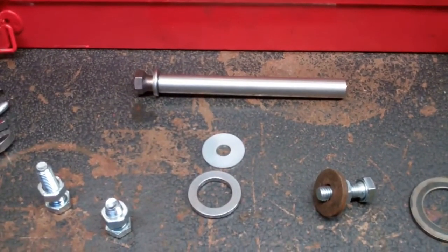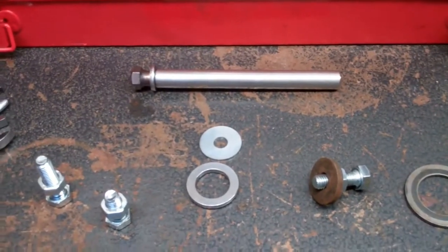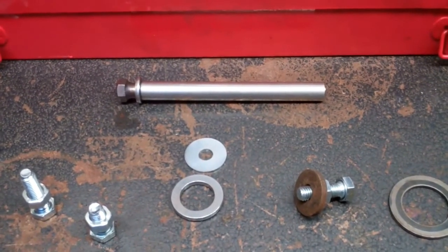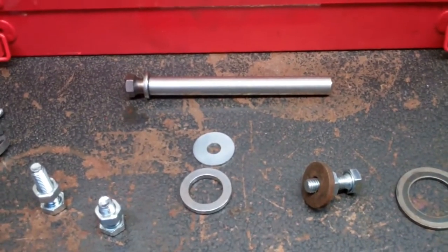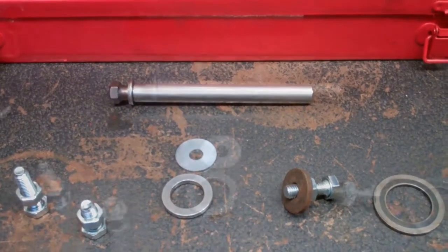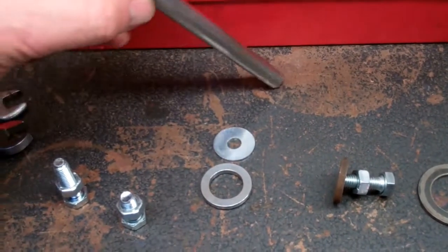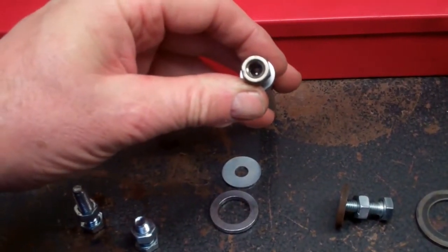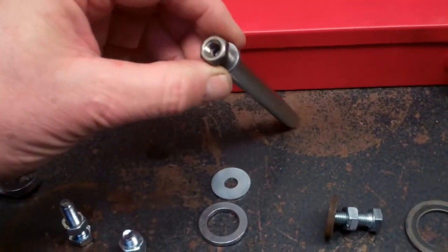So I decided to take it back out again to see if I could replace the spacer. I'd also ordered a new axle, which you can see there. And I attempted to take the axle out, and it stuck. I spent quite a few hours trying to get it out without success. Then after talking to Harry, he pointed out something I'd missed — in the end of there, there is a six mil thread for that eventuality. I'd missed that totally.